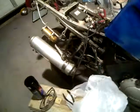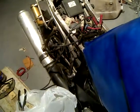Well, until then, YouTube, I'm going to let this guy charge overnight here, see how it goes, check it in an hour for excessive heat. But I think that I should notice a difference tomorrow in starting and stopping, because it's those cold cranking amps that I'm lacking in this. Because it's the strangest thing, I'll hook it up to the charger slash starter, and then boom, she fires up after 60 seconds of wanting to fire up, which is the real difference in it.